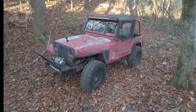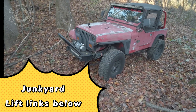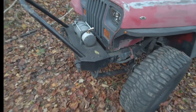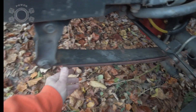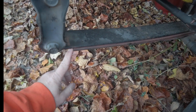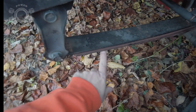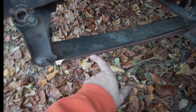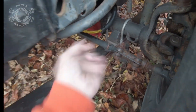The suspension lift is about 2.5 inches and comes from a GMC S15 or S10 truck with leaf springs in the rear. The factory YJ main leaf stays — don't disconnect it from your hangers. The main leaf out of the S10/S15 pack goes in as your second leaf: cut the eyes off the S10/S15 leaf and install it in place of the factory YJ second leaf, which you remove completely. The arrangement is: YJ main leaf, S10/S15 second leaf, then the remaining YJ leaves. Be sure to replace U-bolts and centering pins — I've got videos on that.